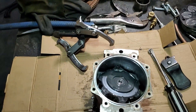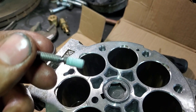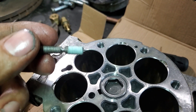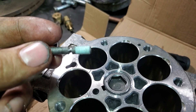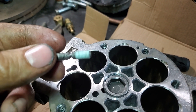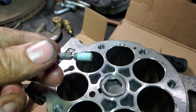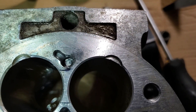To plug that hole, I took a screw and ground it down with a zip disc. I've already got the hole threaded — the idea is to tighten the screw down until it breaks off inside, completely plugging that port permanently. That port was the original oiling passage for the compressor pistons to go from the pump side to the crankshaft side. We're eliminating that passage because we want air on this side and lubrication on the other side. It tightened down and broke off just like I planned.